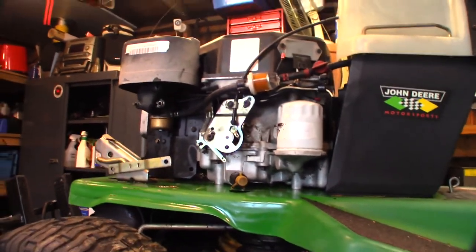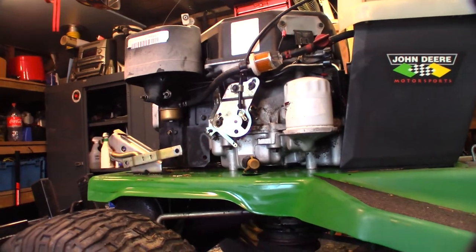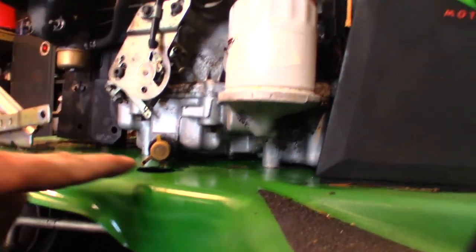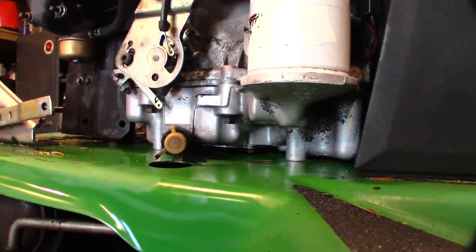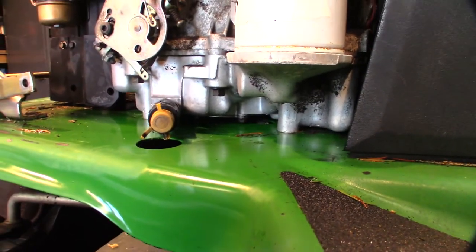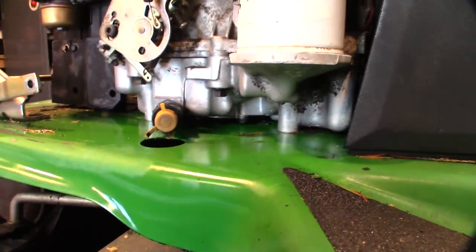So I made sure the oil was topped up, and I just let it sit. I brake cleaned it so it was nice and dry, shot it with the blowgun so it was perfectly dry. And after a while, I could see that plate is getting wet. So there's my oil leak. We're going to get it running. Anyways, I have to order that O-ring because it's not just a round O-ring, it's got a shape to it. And we'll have to pull the motor off to change it. But let's see if it runs first.